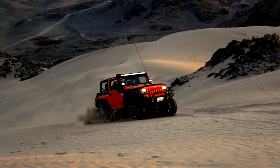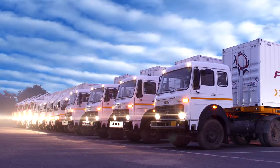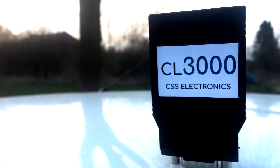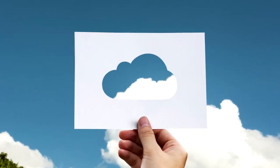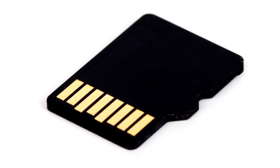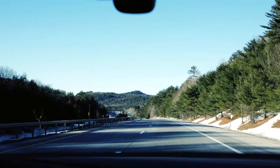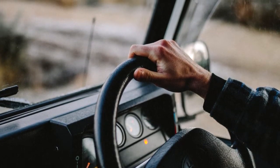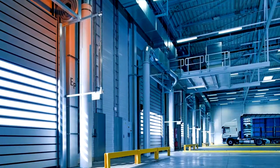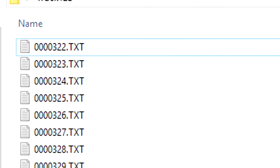The above are useful to pull ad-hoc specific files on a need basis. But what if you want to get all data from 50 trucks daily? This is where our push functionality comes in. FTP Push — in both AP and STA mode, the logger can be set up to automatically push new log files to an FTP server. Once a log file has been uploaded, it is deleted from the SD card to free up space and avoid duplicate transfers. Example: you need to collect J1939 data across 50 trucks on a daily basis. With push mode, log files in a truck can be uploaded on the go via the shared internet from the driver's phone, or the data can be uploaded when the truck returns to the garage and loggers come within range of the local router. In both cases, the data can be automatically pushed to a single folder for easy processing at scale.